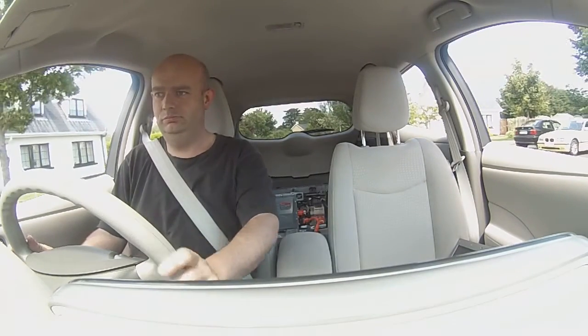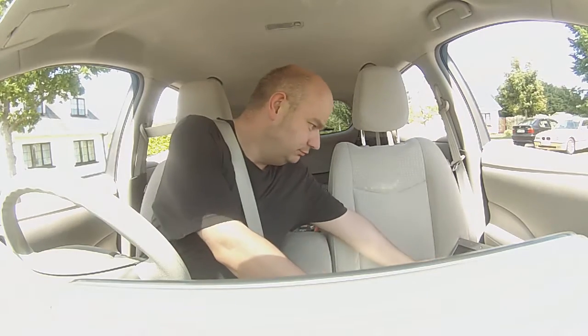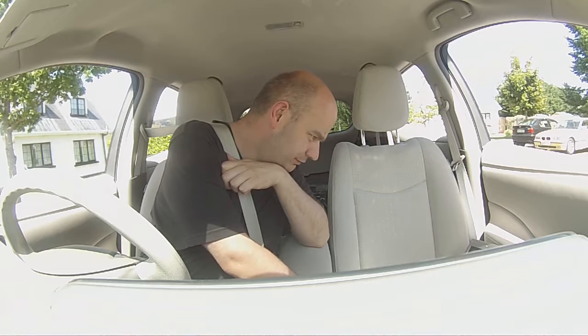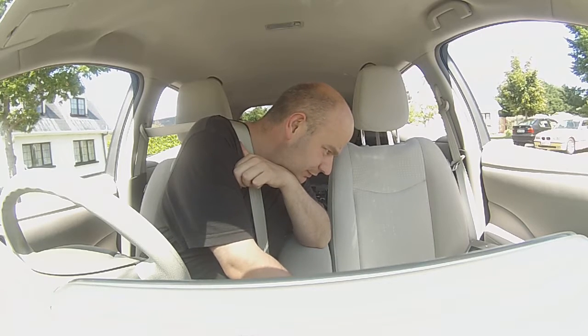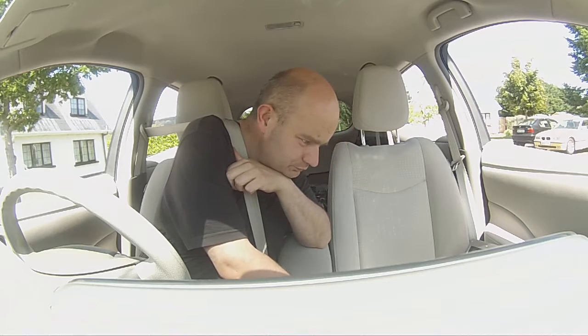Alright, next thing we need to do is a power on, handbrake off, and I want to do eco. So this is going to be eco wide open throttle. Handbrake, car off. Save log file. Call it wot in eco. Text. Wot in eco. Save. Clear frames.